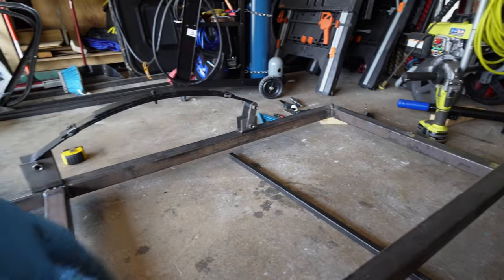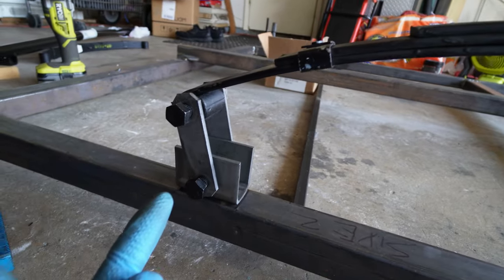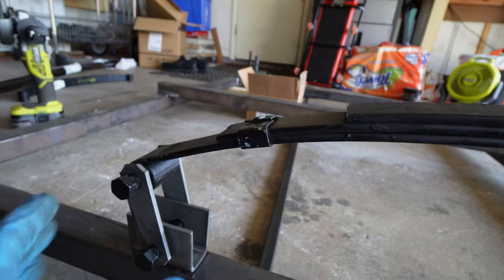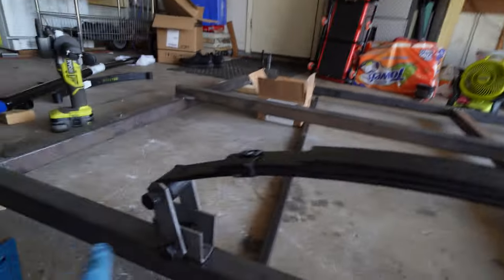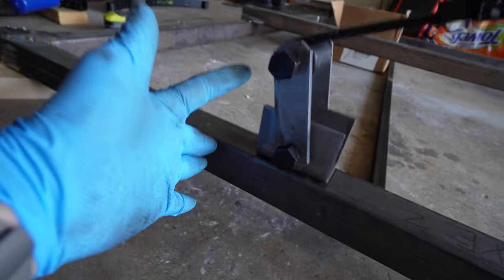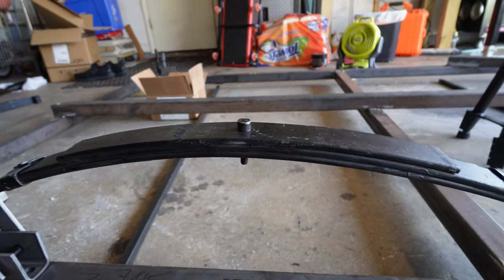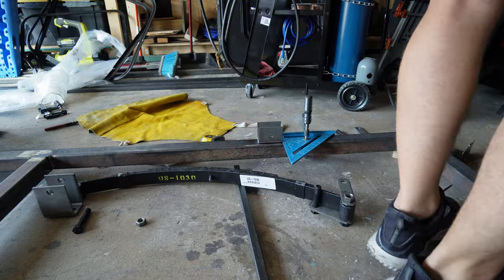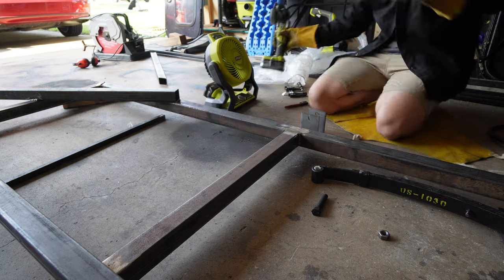This is how these work: when your axle is weighted and weight is applied, these are going to level because your spring is going to flatten out, which is going to push this end out. This gives us an extra several inches of travel along with the flexing of our spring. So once you get it mocked up, go ahead and grind those metal pieces again, make sure you've got all edges, butt it up against your speed square, and then just tack it in place.